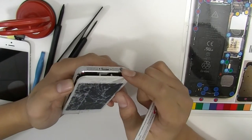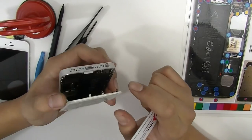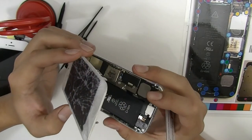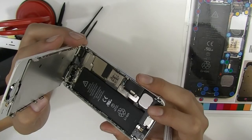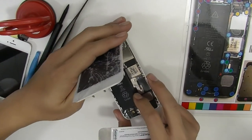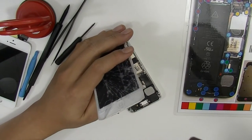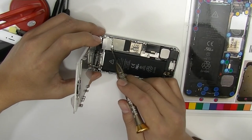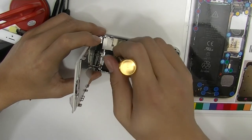When you do this you've got to try and be careful not to go too deep and damage the wiring on the bottom. After you get it open, you're gonna have to keep it at an angle so it doesn't rip off the connectors or the ribbon cables on the top. Now you've got your Phillips screws — there are three screws holding the metal panel for the connectors.